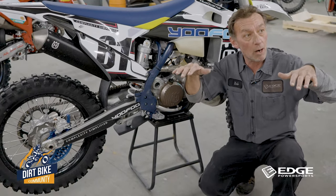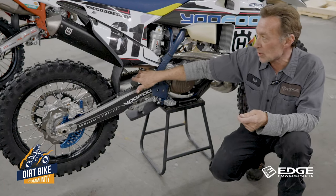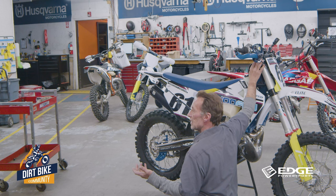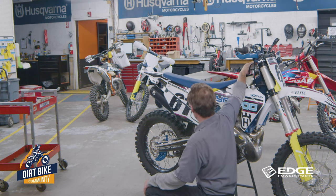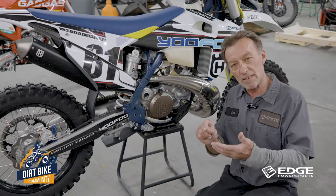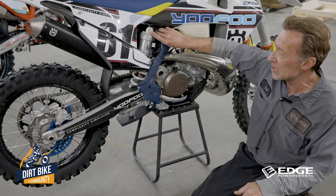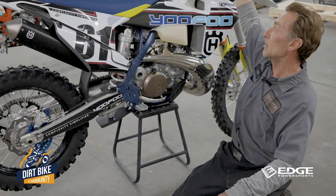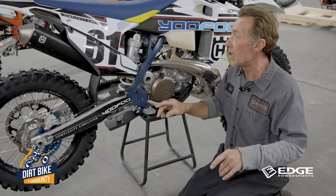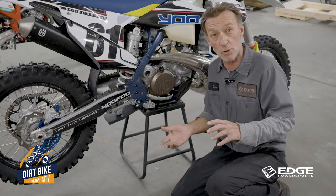My best suggestion is to write down your base settings. Get your preload set, set your sag on the rear shock, and get your preload set on the front. Usually about 150 PSI on the air fork is a pretty standard starting point. If you don't have any telltale rings, put a zip tie on there for a visual cue. Write down those base settings, then go out and do the same thing over and over — same bump, same jump, same turn — but focus strictly on high speed compression first. If you've got adjusters on both forks, remember to set them equally. Once that's feeling sorted out, then start focusing on rebound. If you treat them like two different chapters, it's a lot easier to identify how the bike is reacting.